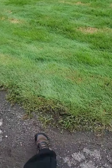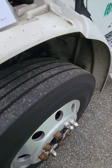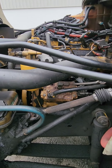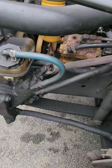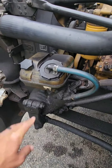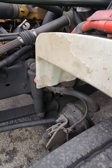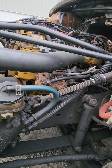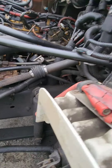The steering system is on the other side, so let's go there. You could mention that if the coolant was low, you'd have to wait until it's cool to the touch before filling it up. Over here: check for fluid — I don't see any leaks on the floor, no power steering fluid leaking, no oil leaking. For air leaks, you have the air compressor on this side — I don't hear any hissing, no air leaks. No fluid leaks either. You can check that off — we've done the whole front of the truck.